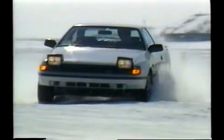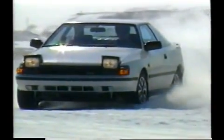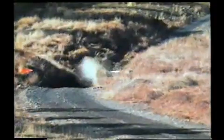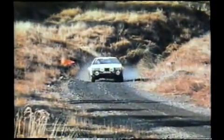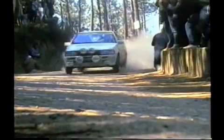Sudden application of the brakes causes the wheels to lock and slip. The car not only continues to move, but there is a loss of direction and steering control. When good drivers are faced with such a situation, they will apply brake pressure gradually and maintain steering control.